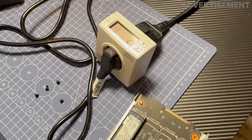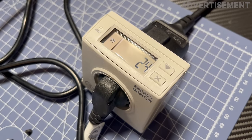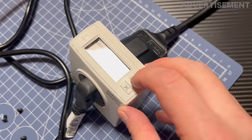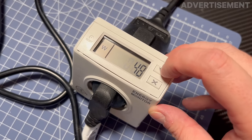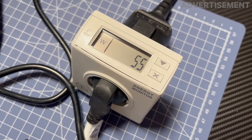One last thing: power consumption. I measured the Zimacube with no hard drives, additional NVMe, or anything extra — it idles at 23 watts, which is a bit more than Icewhale advertised, though that may be prototype-related and could improve in the final product. With four hard drives and two NVMe drives loaded, it goes up to 48 watts at idle — it can go higher under load, but that's a reasonable baseline for a fully loaded device. Sure, it's more than a Raspberry Pi or Zimaboard, but this gives you a good rough estimation.